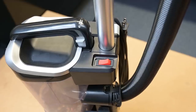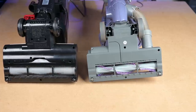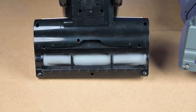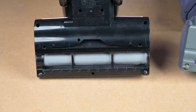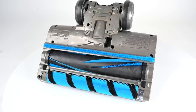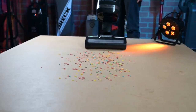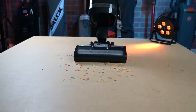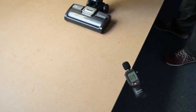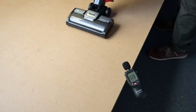One thing I didn't care for: unlike the old version, where switching to hard floor mode causes the brush roller to shut off completely, on the new version it just slows down. This is because it doesn't need to stop completely since it has that felt strip, so it won't scatter debris if the roller is on. But with this one, when you switch it to hard floor mode, you can feel and hear the brush continuing to engage hard floors, which makes it handle differently and about one decibel louder. While I'm almost positive it won't harm hard floors in any way, I know some people are really twitchy about this, so I thought it was worth mentioning.